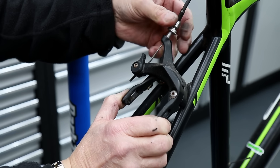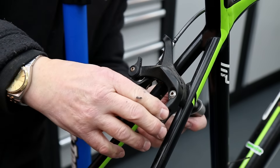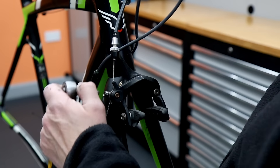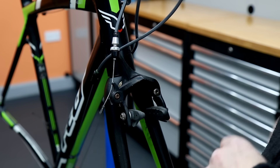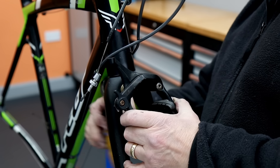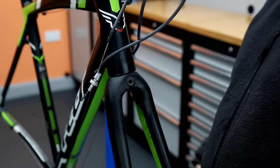We're going to replace the rear brake pads — they were very worn, gone through the little grooves down to a surface that wouldn't brake very well. We're also going to take off the front caliper, get it through the ultrasonic cleaner, re-lubricate it, and make sure it's operating correctly — we do that with all the components.